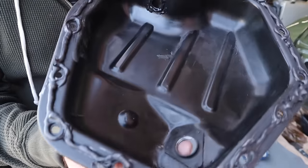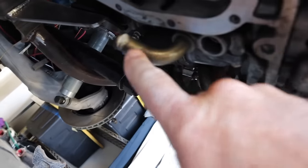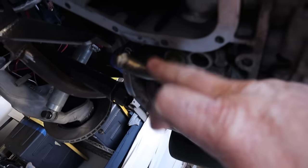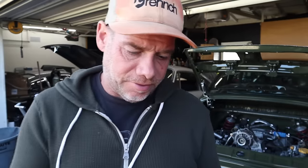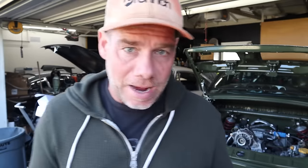This thing is going to probably goop out quite a bit, but that's okay. Let's get this thing installed. I actually need to remove these two coolant inlet tubes — they sort of go where the thermostat is — and since the oil pan is off it's a lot easier to get pliers on here. For those coolant holes in the engine, I've picked up a bunch of plugs and a tap kit. While I'm in here, I'm going to tap this and put a little sealant on it so it's sealed. What's cool is I can always screw an NPT thread into it and have an AN fitting — so if I have some other reason to use that port down the road, that's an easy option.